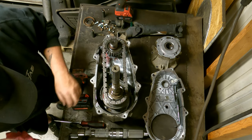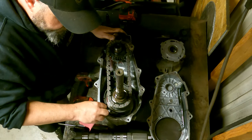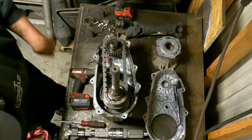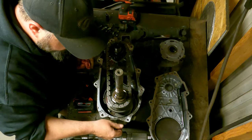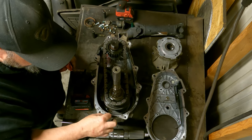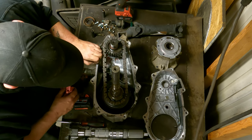Be careful too when you're doing this — these aluminum castings are like jagged bread knives and they will literally cut you up like you wouldn't believe. You can see how easy that RTV comes off — you can just peel it right off. Don't use any sort of grinding wheels or whizzy wheels on this because it is a machine surface relying solely on RTV to seal it. There's a machine pattern in there that holds onto the RTV and keeps everything sealed up — it's something you definitely don't want to get rid of, otherwise you'll have a very leaky transfer case.